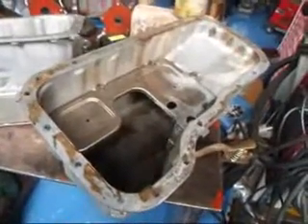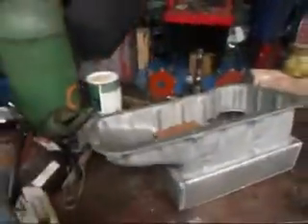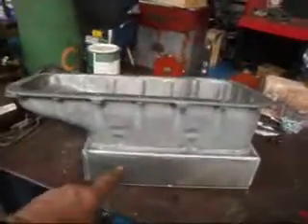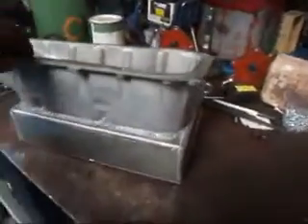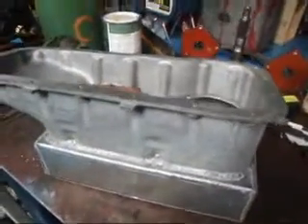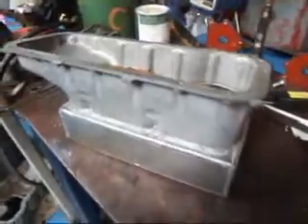What we do for racing Fiats is to modify this pan by whacking off the bottom of the pan and actually constructing a box to weld on. I want to show you this box and why we do it the way we do it, so you understand the importance of good oil pan design.